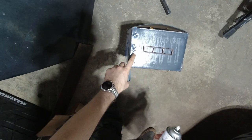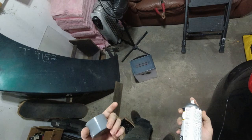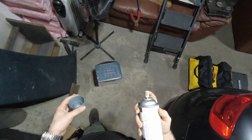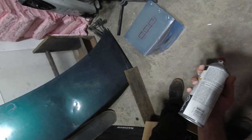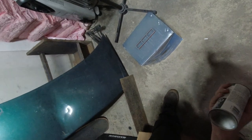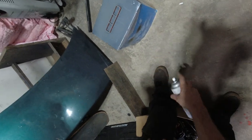The only downfall of this being enamel paint is it takes forever to dry. It's tacky right now, so I can do another coat. But before this is actually dry and I can handle it, it's going to take hours, which is why I'm doing this now. Once the backplate area is all painted, I can do a second coat on that because it's just self-etching primer, so it'll be dry in like 20 minutes. And then once that's done, it'll have been maybe about an hour or so, and hopefully I can handle this.